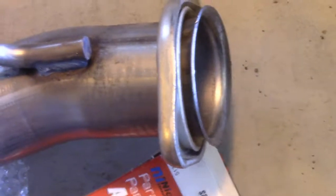So this is what I propose to do: this pipe here I'm going to slide over the exhaust pipe that hooks to the catalytic converter, put our donut on it, and that goes in the muffler — really nice fit. Now I need a flange. I'm going to weld a nut on the top of the U-bolt and then on the bottom of the clamp. So I'll weld two nuts to it, and then I can put bolts through this flange, and that should seal it all up. That's the plan — let's see how it goes.